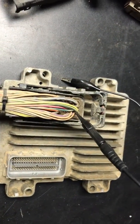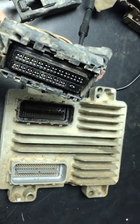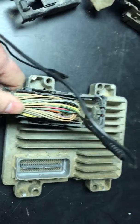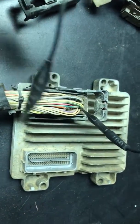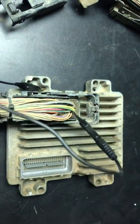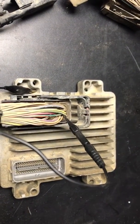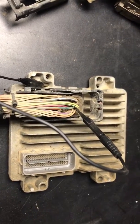So if you have no power at the fuel system control module, you come to the black connector with the black insert on the computer, go to pin 50. You need a back probe — with an alligator clip on it — back probe pin 50, the green white wire, then check for voltage. If you have voltage at the computer, then you know you have a broken wire in between the fuel system control module and the computer. If you have any questions, comment below and I'll do my best to answer them.